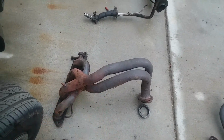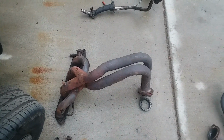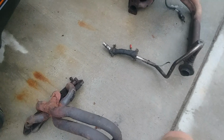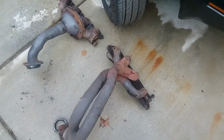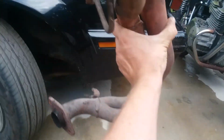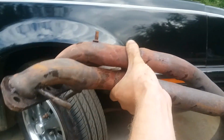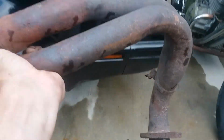The only way to get this out of the engine bay is with a lot of removing a lot of coolant lines, cutting a lot of hoses, and then monkeying around with a whole lot of stuff under the hood. Or the easier way is to remove the head of the engine, then remove this. So if you can picture it from the side angle, it sits like this inside the front of the car. If you remove the head, you can rotate this 90 degrees towards the firewall, like this, and now your downpipe tube, you know, the last 10 inches, it can now go vertically straight up if you have the head removed.